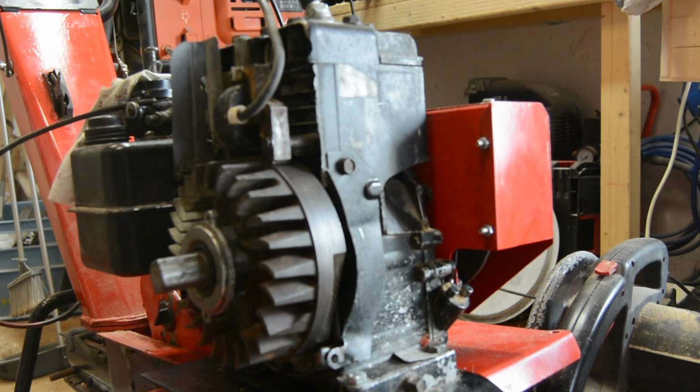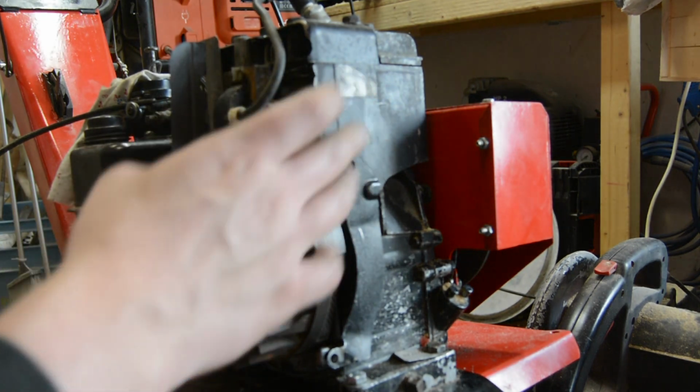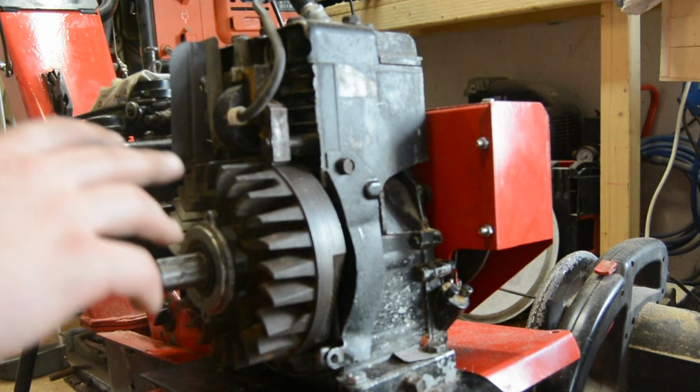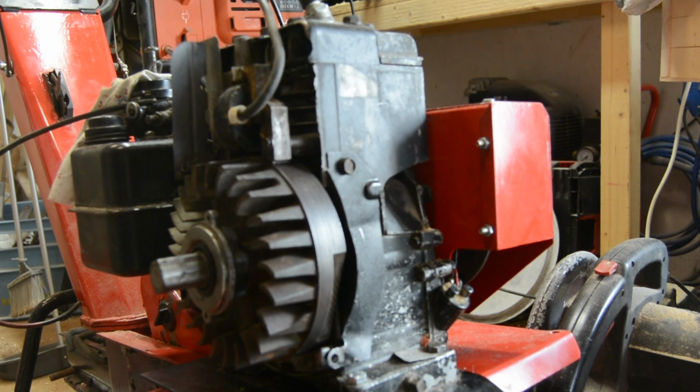Right. I was hoping for more of a positive spin on this, and for this to be the last video on this tiller. Cannot wrap my head around it. But take the clutch flywheel off, open up the points, take off the cover to the points, basically just look at them, let them breathe for a bit, put everything back together, try for spark. Excellent spark. Might have the engine running. Try to start it again. Nothing. No spark at all. Once I have a solution to this enigma, you'll hear from me again. Until then, it seems I have to do manual labor.